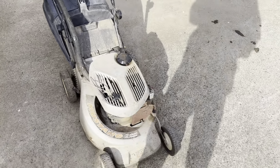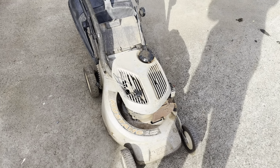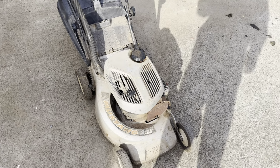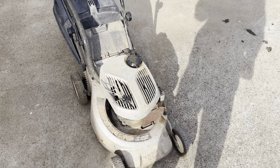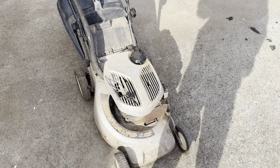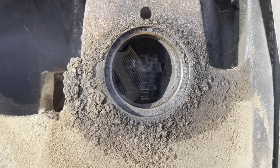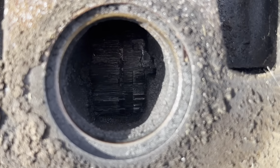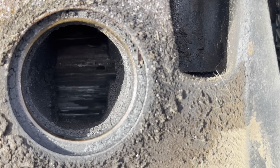So before I sink any money into a two-stroke, I always just pop the muffler off and gauge an opinion on what the rest of the motor's like. Because you can see the piston and rings through the exhaust port. Exhaust port's the hottest part, so if there's damage there, there'll be damage somewhere else. The way this one pulled over, I don't think it's that bad, so let's just get that muffler off and have a look. That's exactly why I always pull the muffler before wasting money on a dead motor.